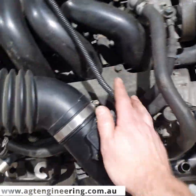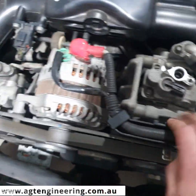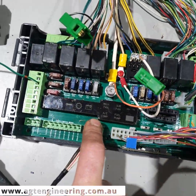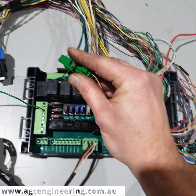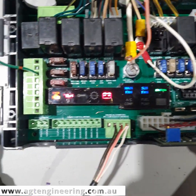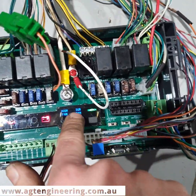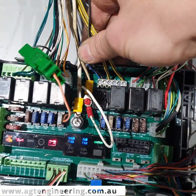We've just got the airflow meter connected. The other connection is the alternator harness, which runs back up into the interface box on the alternator plug. Being an H6, this runs a variable speed fan controller, so the fan relays are on constantly — that's also hooked up through here, so we've got the fan hooked up as well.